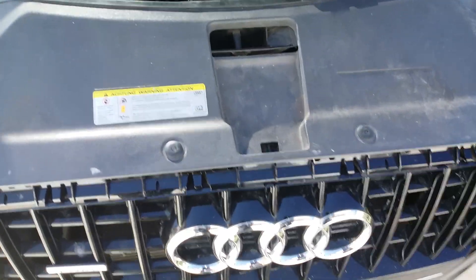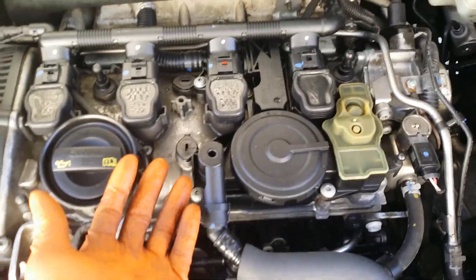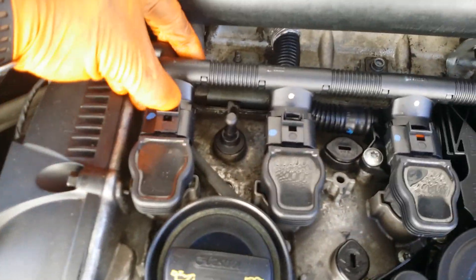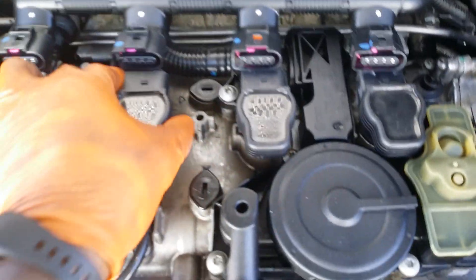What we're doing is the Audi Q3 spark plug replacement. There's usually a little cover here — pretty much pull up on it. There's one missing here. Doing the plugs on it: basically you just squeeze these little tabs here and separate that from your ignition coils, then pull up the ignition coils and take them all out.